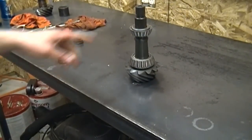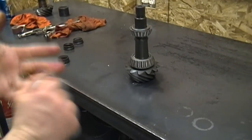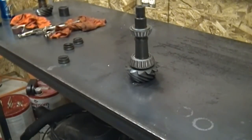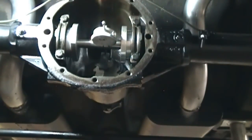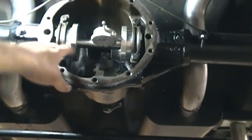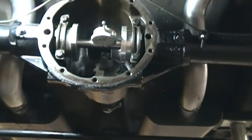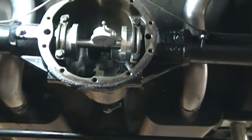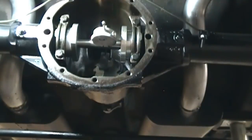I'm probably going to install the seal after I come up with my finished shim for the pinion — no need to pass the pinion back and forth on that seal. I have my mock setup put in the rear end with no crush sleeve, just snugged up. The Mark Williams pinion depth checking tool shows that the factory shim is just about perfect — within a thousandth of an inch. I've taken several measurements rotating the pinion.